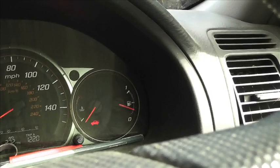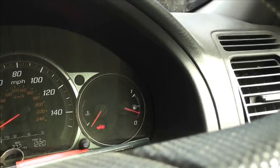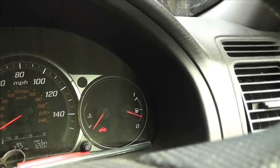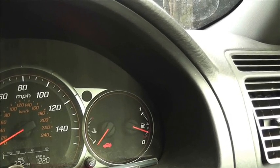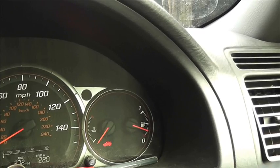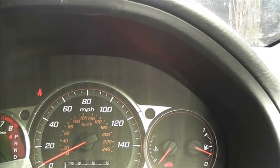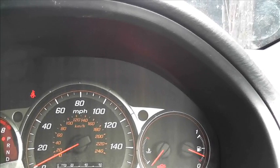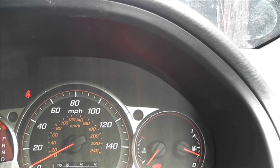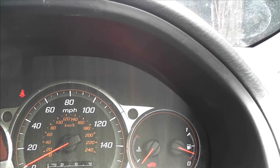Just mind-blowing, these sort of things. A friend of mine was telling me about one of his Fords, a Ford Granada, and he was having problems with the fuel gauge. On those earlier cars, that sort of era, the whole display was mounted on a flexible printed circuit board. After a huge amount of investigation, an hour here, an hour there, and a week later an hour on it, he found there was a fine crack in the track on that flexible circuit board.